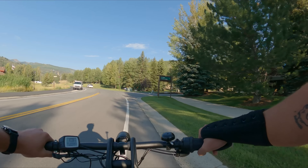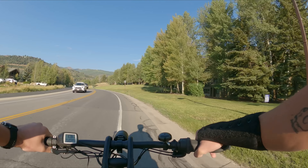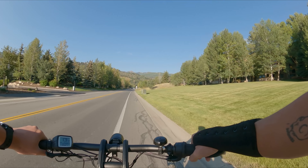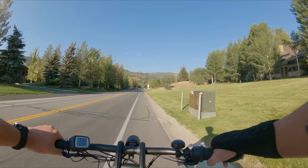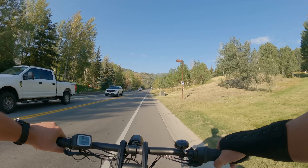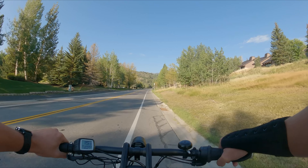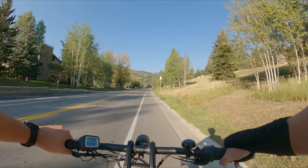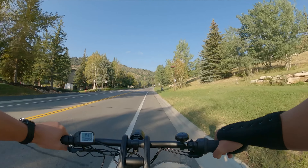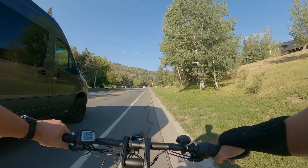This is a loop we've done several times here in Park City on different e-bikes, and this is probably not the quickest lap, but that's okay — this is a cargo bike. It's not designed to go super fast, and carrying this much weight at a higher speed wouldn't feel great. We're going about 14 to 15 miles an hour pretty comfortably. It's also got an Enviolo hub — not the automatic version. They built this to carry a lot of weight, so they chose the mechanical Enviolo so it could handle more torque. It uses grip shift with continuously variable shifting — no discrete gears, just a continuous adjustment of effort as you twist the shifter.